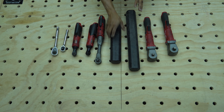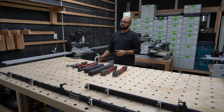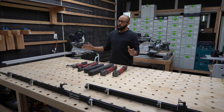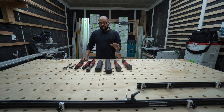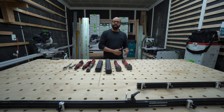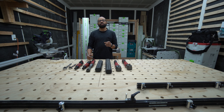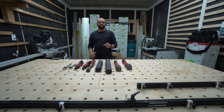These are torque wrenches. As I progressed in my auto mechanic skills when I was younger, I would change things like brakes and just snug it up past tight and call it good. But over time, reading my auto mechanic manuals, I would see something called a torque spec. As I've grown in my skills I've decided to move closer to being like an ASE certified mechanic — not that I am one — but using those torque specs to my advantage, because they basically make it so I'm not going to snap off the head of any bolts — ask me how I know — and the bolt is not going to come loose because I tightened it to manufacturer specifications.